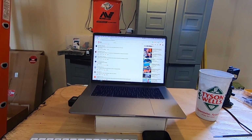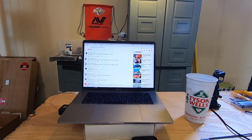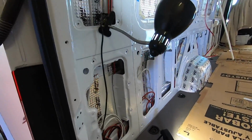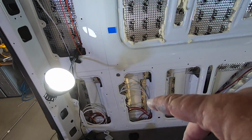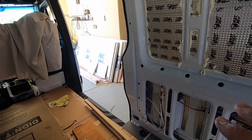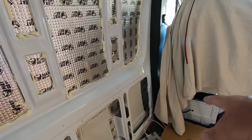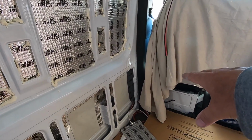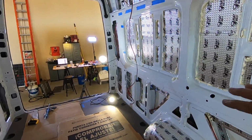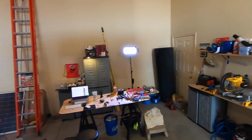Rick said, Russ, add extra wiring in case you need more goodies in the future. Actually, I don't need to. That's a great question. Let me show you something. This van, the way I wired it, it's going to have 3 fuse panels. The main one's back here. This is a 10 gauge wire. This cabinet will have its own fuse panel, 12 volt, and 110. Up here, where it's going to go to the engine, I'm going to create a fuse panel up here as well. So it has 3. I have no intentions of putting wall plugs in this thing, because it's going to be all cabinets. Time this thing gets built, there's really not much wall area left. That's a great question, Rick. Thank you.